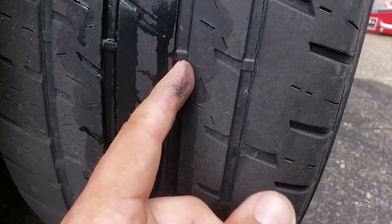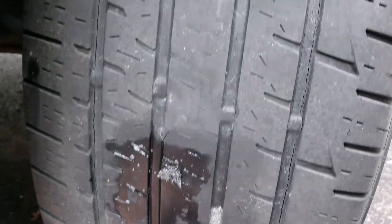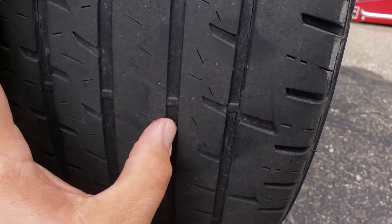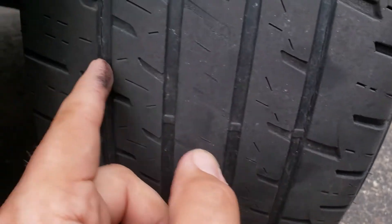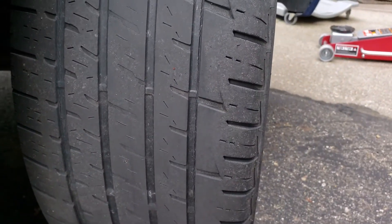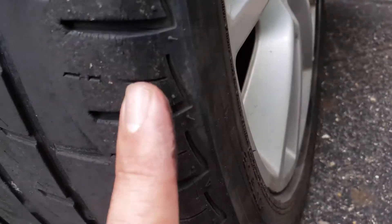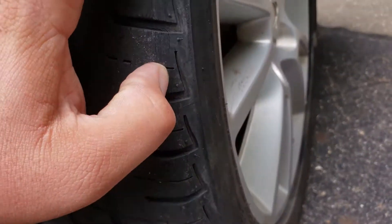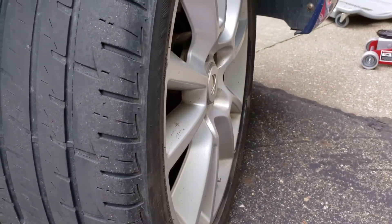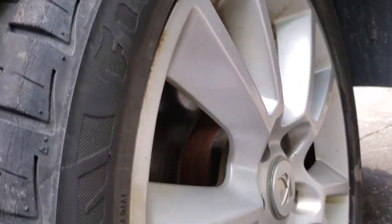This tire really needed to be replaced anyway — these are wear bars, it's at 2/32nds, which would severely compromise the ability to shed water. Had I hit a pool of water or a really rainy road, there's a good chance I would have hydroplaned. You can also see these cracks inside — I mentioned in an earlier video that these were more than likely due to someone driving it faster than they should, or doing burnouts. The dry rotting on the side is more than likely from stress due to overheating, possibly from running very little air pressure. More than likely these V-rated tires — someone figured out they had speed-rated tires and decided to go as fast as they could.